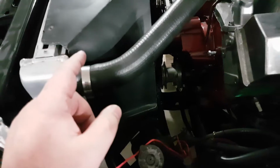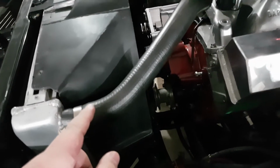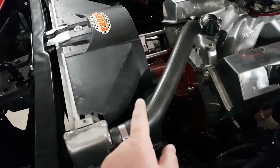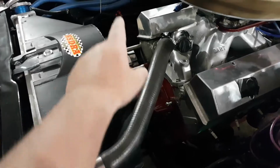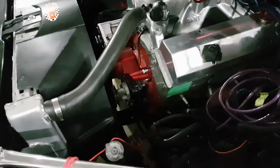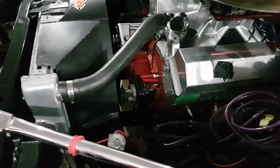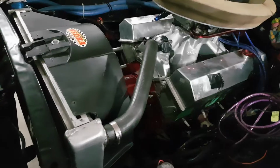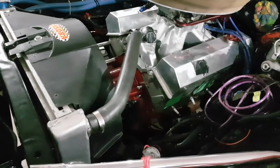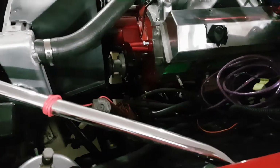I have to go through my stock of belts and see if I can find something, because that's a mid-mount alternator now, and my other belt was where it normally is, up high on the passenger side. So we'll get the alternator shimmed out where it should be. I'm not exactly sure if them spacers are right that came with the bracket, but we can cut or shim them to fit. Get the belts running true,